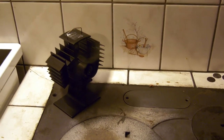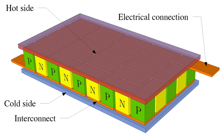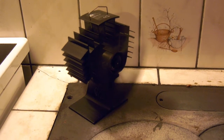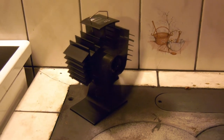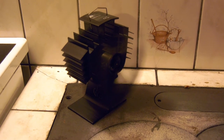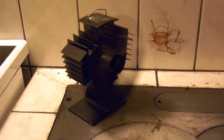The more complex version is that the fan is divided into a massive bottom that collects the heat, and a top that is the heat sink. In between these two parts, there is a Peltier element. If you put electricity into it, one side gets cold and the other one gets hot. But if you instead create heat on one side and keep the other side cold, then you get electricity. And it's that electricity that runs the motor that spins the fan. As the fan drives the air through the heat sink, it keeps the heat sink cool so you can continue to produce energy. And you get that cozy heat in the whole room.